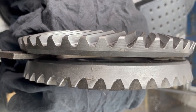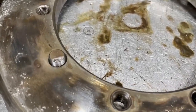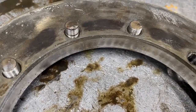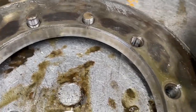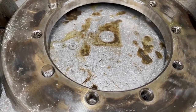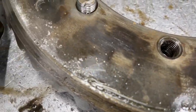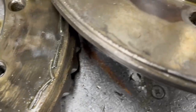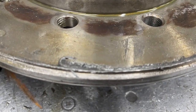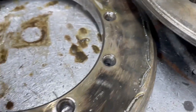We've got a fix for this as well. When the bolts break on the crown wheel, they get properly jammed in. You've got a very hard crown wheel and a 12.9 grade bolt, and your chances of getting those out are pretty slim. As you can see here, that is swarf. It rattles and chatters and picks up on the actual unit itself. That groove shouldn't be there — that should be a smooth surface. So it's completely destroyed the centre as well.